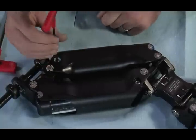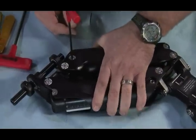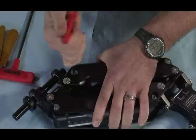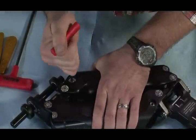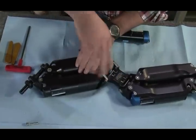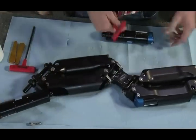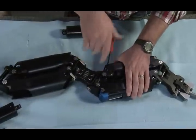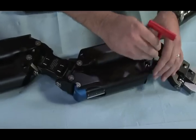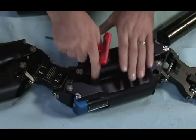Put your tool in there and loosen the screw. Take either your left or right hand — I use my left — and squeeze these bones together. At the same time, put a little pressure on that allen wrench and just pull your bolt out. Make sure you get the threads out first. The canister comes right out. Move to position number two, loosen the bolt all the way, squeeze the bone and extract the bolt. Position three and four: squeeze the bones and pull it out. The reason you're squeezing is you're compressing the bumpers inside — that's all.